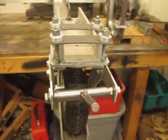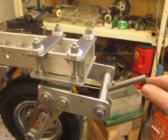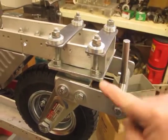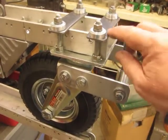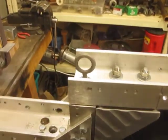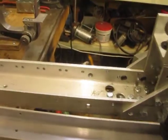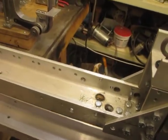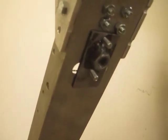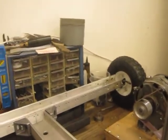I had to move the steering out, extend it out, because as it turned it would hit into that corner piece when I made sharp turns — so I just extended it out a little bit so it would clear. I also turned it so that the lock bolt was up on top. There's the eye bolt for the tie-down. And I put a half-inch nut onto a steel plate and bolted it down there for the leveling jack with the landing pad on. That's a half-13 nut just tack welded to that piece of metal, and it turned out pretty good.